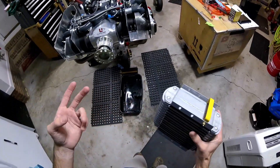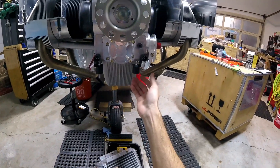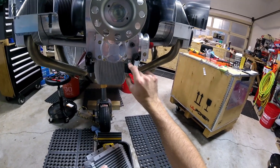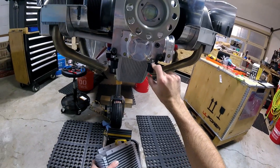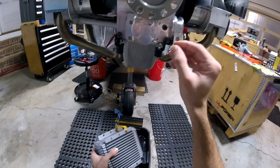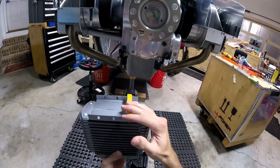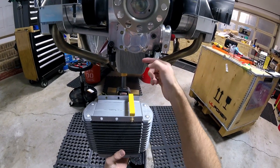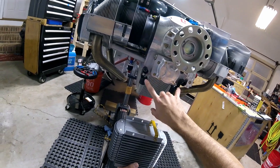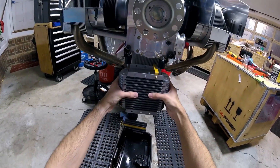One thing is that you need to make a mount for it, because Zenith makes these mounts that come in the firewall forward kit from Zenith — not from UL Power, which is kind of weird. These mounts are made for the UL Power oil cooler. So what I'm trying to do is basically make a bracket to hold this one. I'm going to use these mounts that bolt onto the engine case here — they've got rubber vibration dampeners. What I want to do is basically attach this cooler right on there.